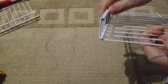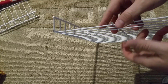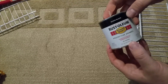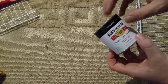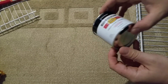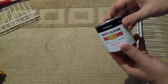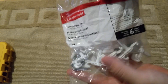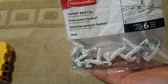Next step: I highly recommend touching up the corners of the shelves on both sides, otherwise over time they can get rusty due to moisture in your refrigerator. For this I recommend using Rust-Oleum enamel paint — just touch up with a small brush. I'm currently using black; I don't have white on hand but I'll purchase it and finish the job later. I find these work perfectly and look like they were made to be there.